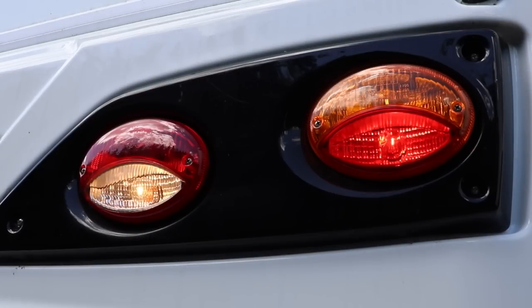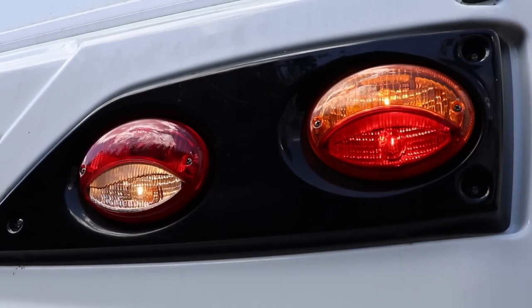That seemed quite a good way of checking the lights until we purchased this car, which actually had quite a few funny electrical gremlins in it. When I put my foot on the brake, the reverse light came on on the caravan. When I put the car into reverse, the fog lights came on. When I put the left hand indicator on, nothing worked. The right hand indicator — the hazards came on. So picture the scene: we're just about to head off, I'm pressing all the buttons and selecting all the gears, Angela's at the back shouting 'yeah,' and as far as she's concerned everything's working. Of course on that occasion, the 'yes' really didn't capture what was going on — there was in fact a cable fault, or it could have been an electronics box being slightly screwed up. In our case it was a combination of the two.